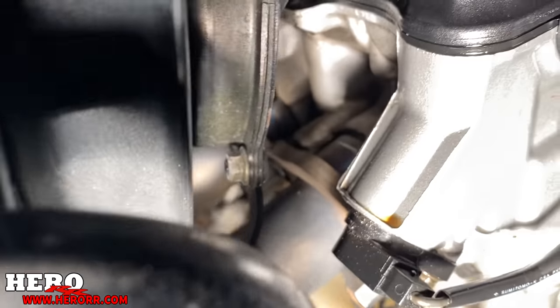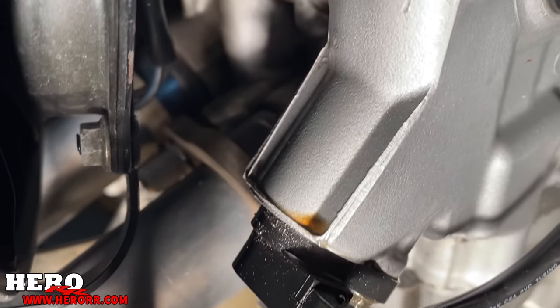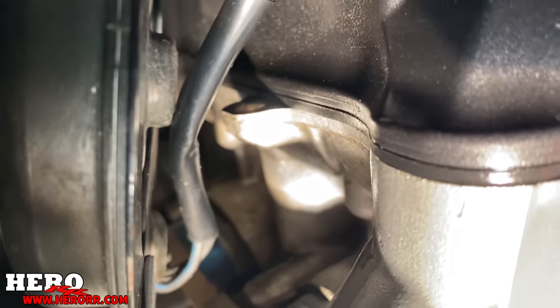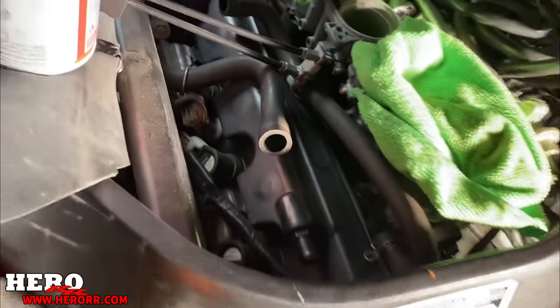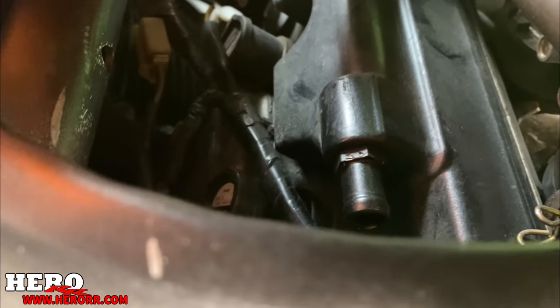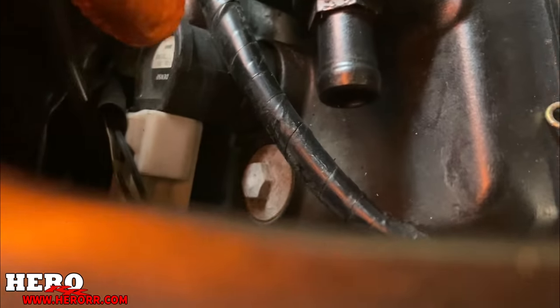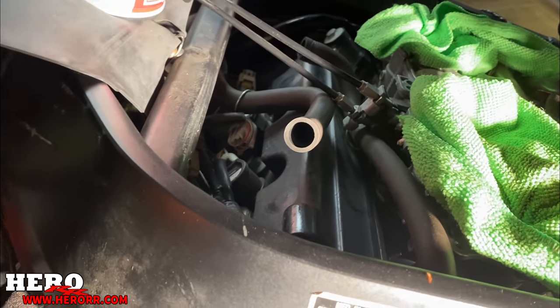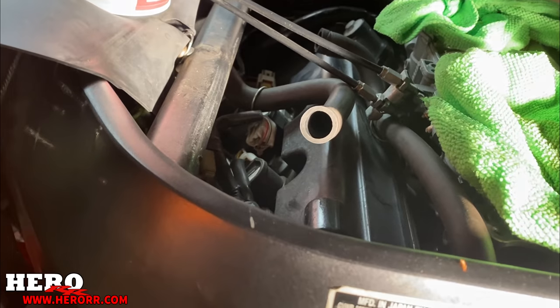So here is the oil leak that I was referring to. You can see a little bit of it pooled up there, and it looks like right up here is a little wet, so it must be coming right from there. Here's the head, the valve cover. I already disconnected these hoses. Next I'm going to have to remove these plugs and the coils and the pair system, and then remove these bolts. I'm going to do this all off camera because I can't get a good camera angle at it.